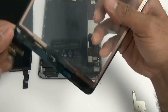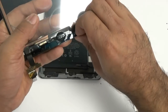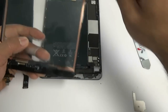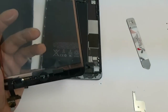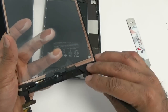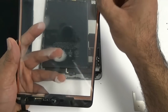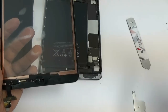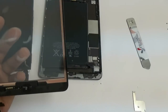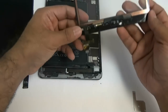Go ahead and grab your new touchscreen glass. There's actually double-sided tape already pre-applied, so you don't have to apply any tape. Go ahead and release the double-sided adhesive pads, and make sure not to stick this to anything because it's obviously very sticky. Also note there is a screen protector on the back of the iPad mini, along with the front. It may be hard to find — use your nylon spudger and pry along the edges. You want to remove it, otherwise it's going to be stuck under there when you lay your screen down.